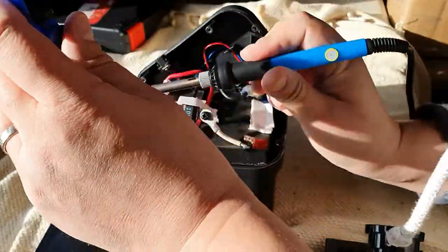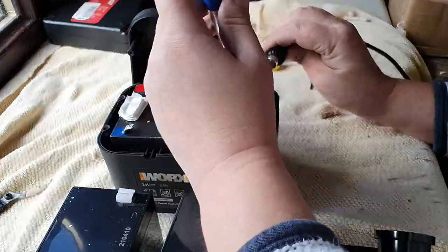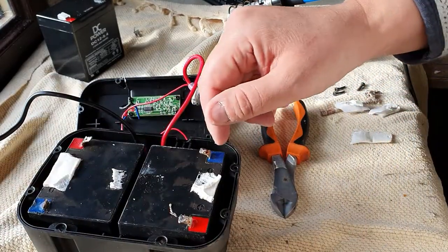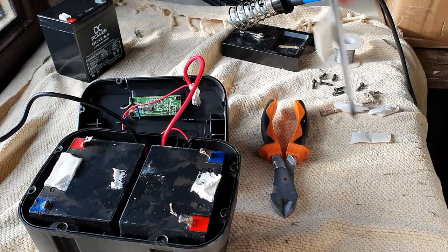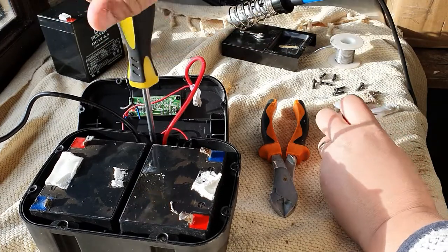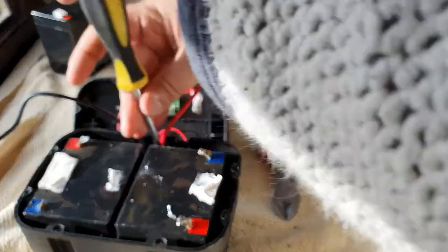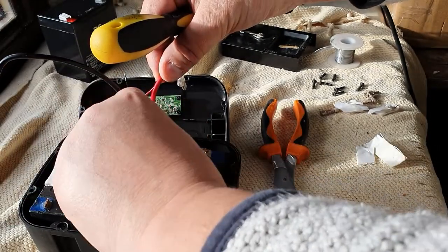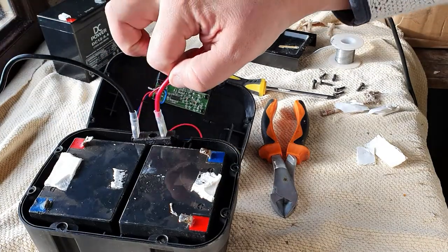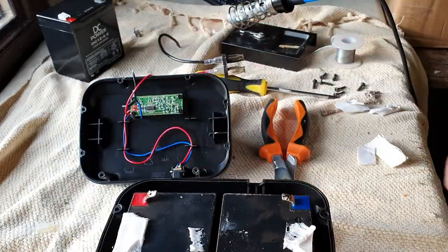That's one off. Now we need to do this one on the negative terminal. And the battery pack itself — what we'll actually do is remove this supply connector. There's a screw just holding it in place, so we can actually get everything out of the way completely. Those are out of the way — they only go back in one way, positive to the left. That leaves us with the battery pack itself.